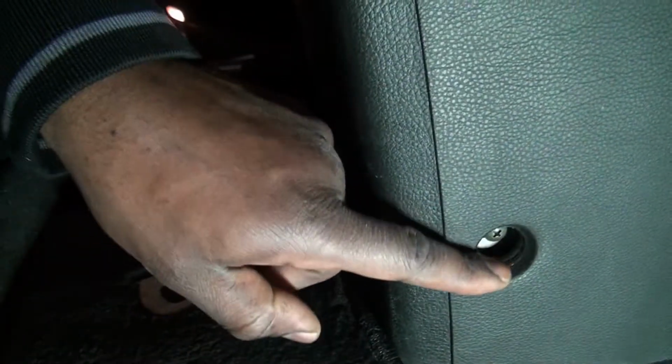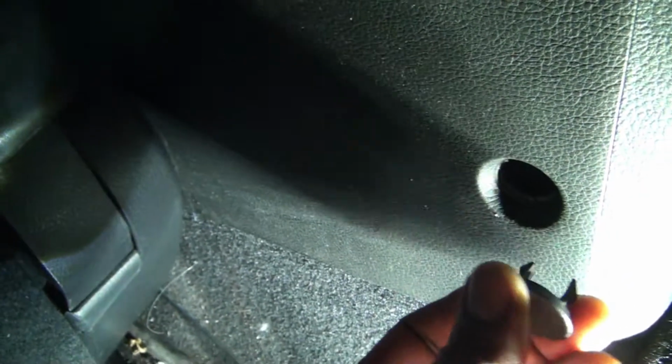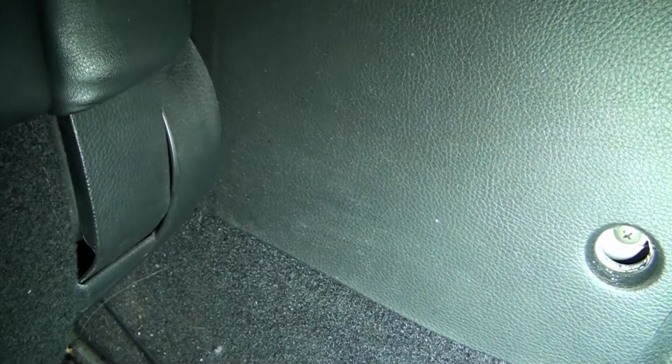So the yaw rate sensor is located here in the center console according to the information. So what I'm gonna do, I'm gonna remove this panel. Now, to remove this panel, you have to remove those little tabs here. They look like this. So you pop those off, of course, on both sides. This side as well, same thing. You pop these off, take them off. And then there is a screw in there. You just grab this Phillips screwdriver and go from there. All right, let's do this.